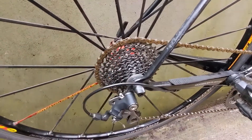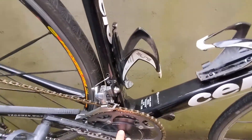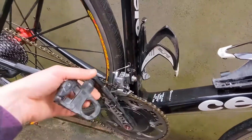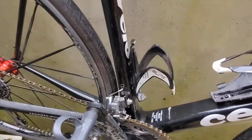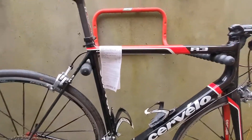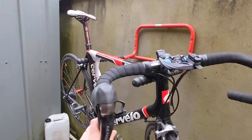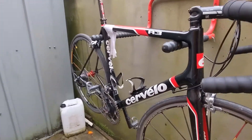The B-spring is the part on the derailleur that can often give some trouble. The chain is checked and replaced if necessary. The bottom bracket is checked for noise and play and replaced if necessary. We give the whole bike a nice clean, and we also put on fresh bar tape. Silver Service completed.